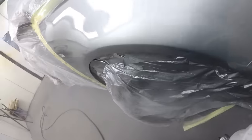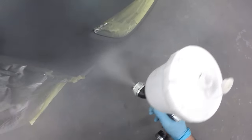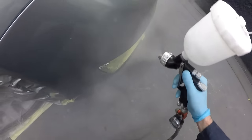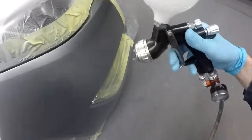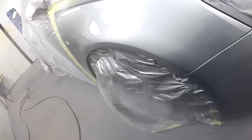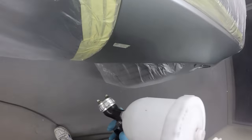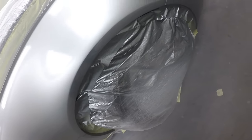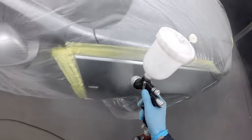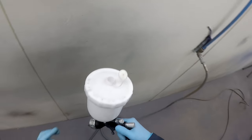As I said, we haven't left much out of this video — really only that 60 seconds of blowing it down with the gun. On the base coat side of things we're only at about the 14-15 minute mark and this job is already on its second coat of clear and practically finished. These little trade jobs can be done quite quickly and efficiently — you can get them in the booth, knock them out, get it baked off quickly, and get the next one in. Finish-wise it's bang on factory with just two or three tiny little nibs.